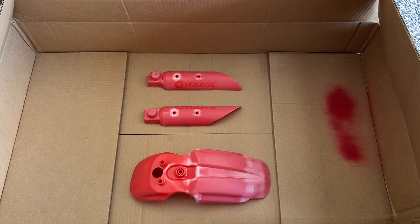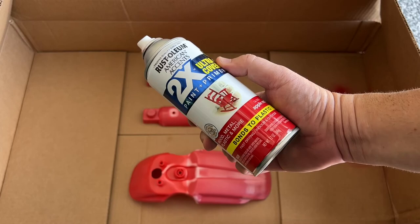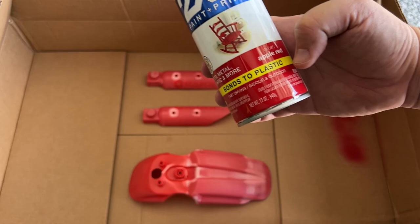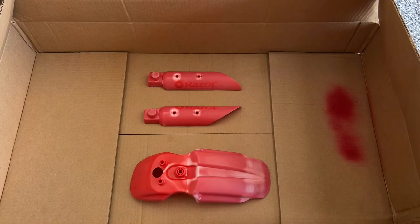So these parts have been scuffed to take the sheen off, they've been degreased, washed, and dried. Now we're going to go ahead and hit them with some light passes of spray paint. This is just some Rust-Oleum that I had laying around in the garage — it happens to be the same red so that I only have to paint the sides that show and it won't be blatantly obvious. It says that it bonds to plastic so we're gonna see. Using this cardboard box here as a makeshift paint booth because the last thing I want to do is ruin my garage floor epoxy.